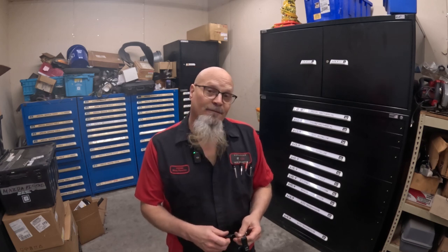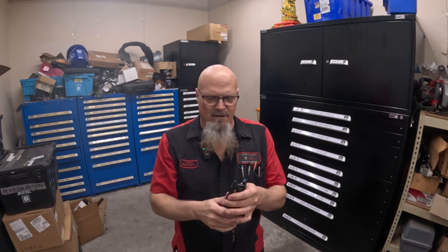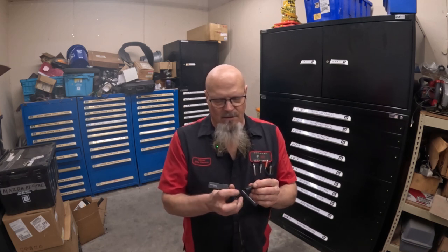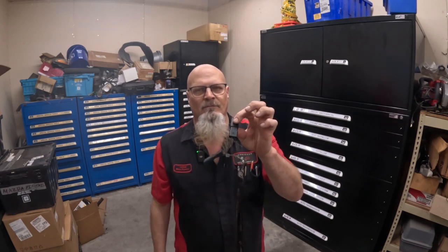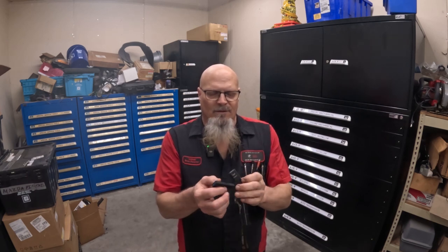Before we can actually install Android Auto Apple CarPlay, we need to do a software update, if it needs one, so we'll check the vehicle and see. I've got these three flash drives here that I put on this lanyard years ago. The update status as of this day, I believe, is 74.00.324. The reason I have three is this one has the latest programming for the Connect Master unit, or the Mazda Connect system, 74.00.324. These other two are really old.